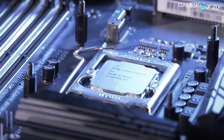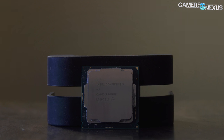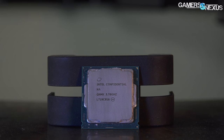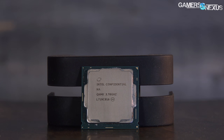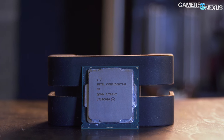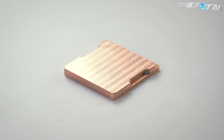One more reason that the custom copper IHS helps here is less about the extra surface area, though there is more, because if you look at the Intel one, it's got that lowered surface around the edges, and the custom one takes the whole surface area. But it's less about that and also about the flatness of the surface. The Intel heat spreader stock is actually very slightly convex, and the Asetek cold plates, some of the other cold plates on the market, are slightly concave. This is to somewhat account for the bend in the Intel IHS, but not everyone does it, and also you've got two modes of manufacturing tolerance to deal with there, where now you're relying on both Intel and the cold plate manufacturer to align perfectly with their concave and convex bends. This IHS is flatter, it removes that, it's basically perfectly flat, and ultimately when you mount it all down anyway, most of the cold plates kind of become flat just from the mounting pressure to begin with. So that's another big contributor aside from the extra surface area.